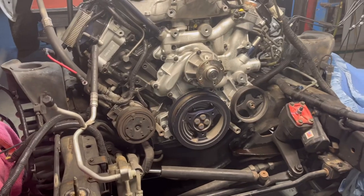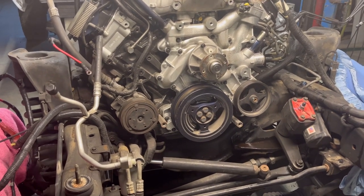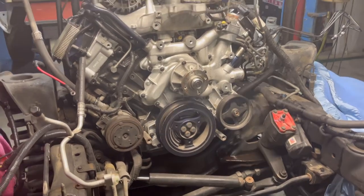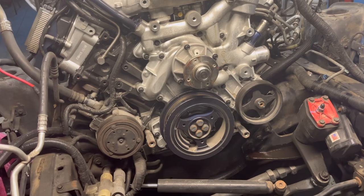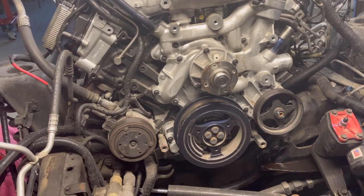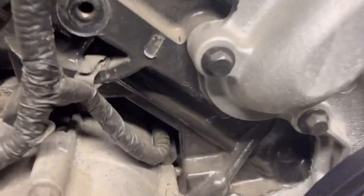You guys think we should expose the mains, or wait and let the parts tell the story? I don't know. Bummer, because when we expose it, I guess it is every single part taken apart on this thing, which means front covers all need to be detailed, the block, the bed plate, everything needs to be ridiculously clean, because the anaerobic is really good for staying, not good whatsoever for taking it off. Generally, you can scrape it off like hard plastic. It turns to dust and seals really good, but not at all excited about taking it apart.